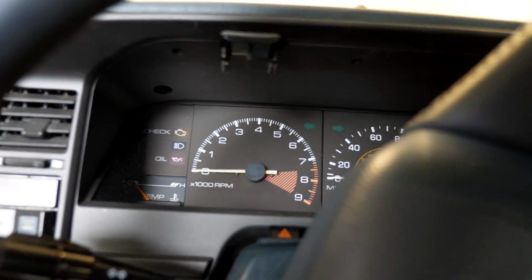With this older tachometer, it does require a special kind of signal where it comes from the distributor and the igniter. The igniter spikes a voltage, and that's how the tach reads a signal. So the way to make that work, we'll figure it out. I got some stuff ordered, but that'll be in part two. For now, just giving you guys an update. Car started, coil on plugs are working, and the next step is gonna be cleaning up the wiring and getting the tachometer to work. Alrighty, until next time.